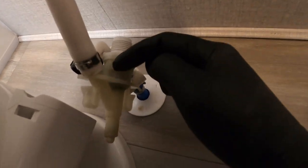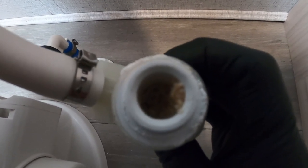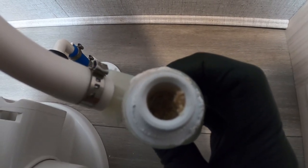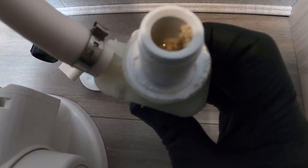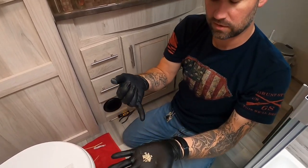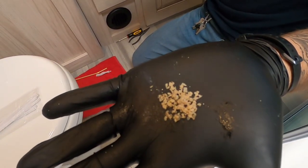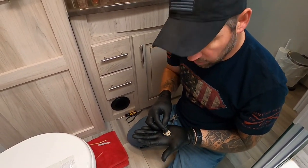We got this out. There is a screw that goes in here first that we had to take out before we could push these tabs out, and once we did, this thing just popped out. Now when I look down inside of here - it's gunked up. It looks like hard water buildup in there. We probably went the first eight or nine months owning this RV without a softener, and I'm assuming that is where that came from. This is some of the stuff that came out of that screen - it looks like sand, but if you look closer it's hard water deposit.